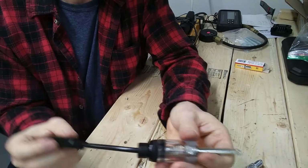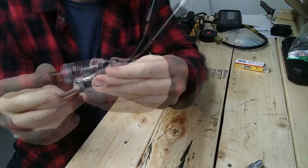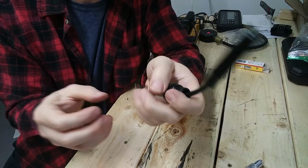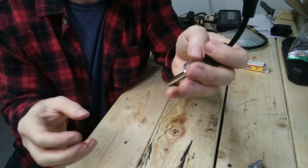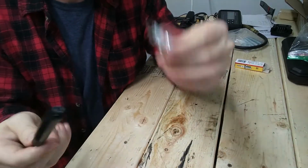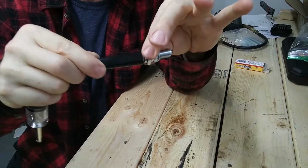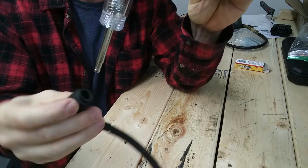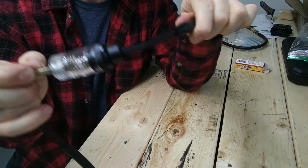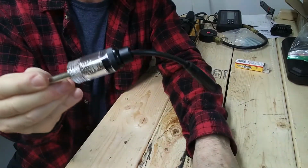This is a lot. And also, doing the spark plug test with this little tool, this light gauge, they actually put the spark plug into the environment that it has to run in, which is under pressure inside the cylinder, which is harder for the spark to operate. So how these work, you can see here, the spark plug goes in here, like this would be the normal high tension line, and then you plug this into the actual high tension line, and you'd see the spark happening in there. So this is a much more definitive test.